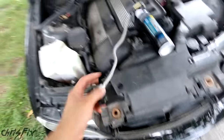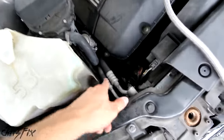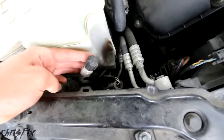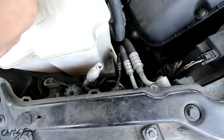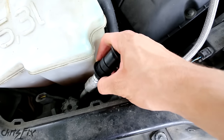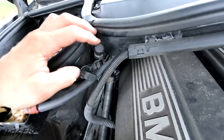The first thing we want to do is connect our AC kit to the low pressure service port using this adapter. The low pressure service port is going to be on one of the air conditioning lines. You can see these two AC lines coming in right here — follow the lines. Right here you can see one of the service ports, but in this case this is the high pressure service port, which we can't use. Sometimes the high pressure port has an H on the cap. Don't worry if you're unsure which is which — your adapter only fits on the low pressure port, so you can't mess that up. Put that cap back on and now we're going to follow our AC lines.